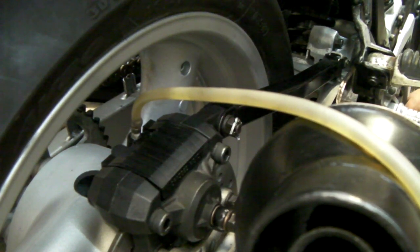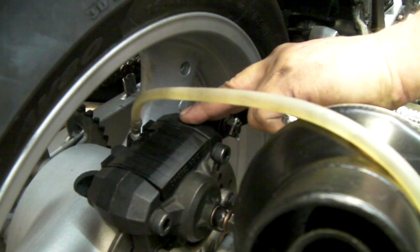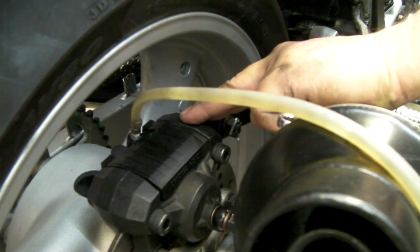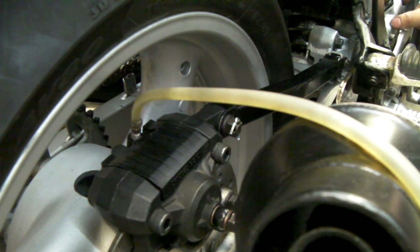I can feel there's still plenty of air in there. The idea of back-flushing is to try to make sure there's as little air as possible in the caliper. Doing it from empty you're pumping away at an empty cylinder, and I don't like doing that — you've got a rubber seal just pushing against metal. To me that feels like it's going to damage the seal, whether or not that's reality. I'm not an engineer or a mechanic, I do this for fun.